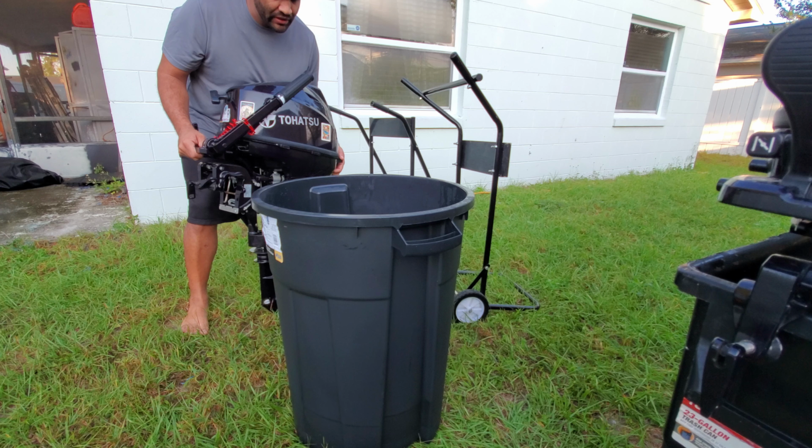As you can see, even though the water is spilling, it's spewing water as it should be. You want to run that for, give or take, maybe 10 to 15 minutes. That gets the job done. And that's basically it. That's how you flush an engine with the muffs.